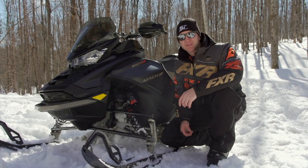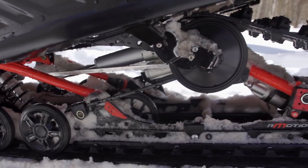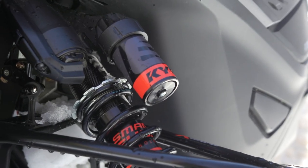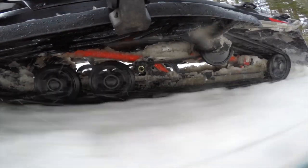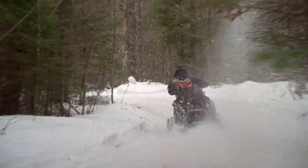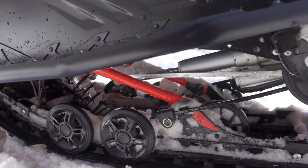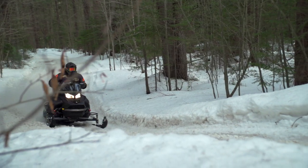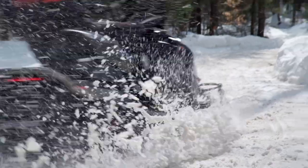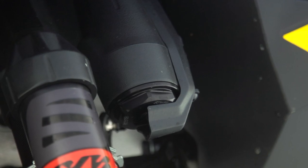Power is a big checkmark on the Mach Z, but the other included premium feature is SmartShox from KYB. They're included in the Mach package — but will you be pleased with them? The lowest compression setting on the SmartShox system is comfort, and in this setting the Mach delivers what I will say with assurance is the best riding rear suspension ever produced. It's ridiculous how plush this skid is. The rear suspension is squatted quite low and the running boards look like they're going to drag on the snow. Whether it's the sag, the shocks readjusting by the millisecond, or both combined with the R-Motion geometry, I'm floored with how good the rear skid feels. In comfort, corner-to-corner is excellent — the system stiffens the outside shock to help with body roll, recognizes when you lift the skis and prepares for touchdown, and when you come into a big G-out or back-breaking bump, the suspension anticipates and compensates. It's beautiful, truly.